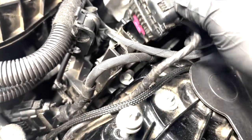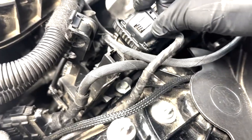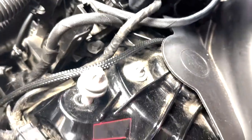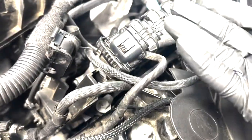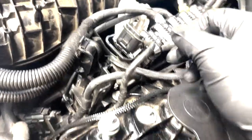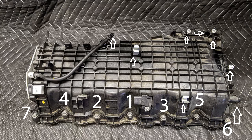As a precautionary step, you can choose to drain your coolant by opening your reservoir caps for both reservoirs, disconnecting your upper radiator hose, as well as disconnecting the radiator hose that goes onto the condenser cooler block — it's directly below the smaller of the two reservoirs. That will allow you to catch most of the coolant in the system and drain it out, but this is completely optional.